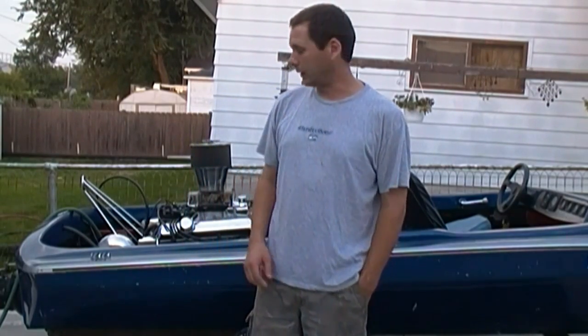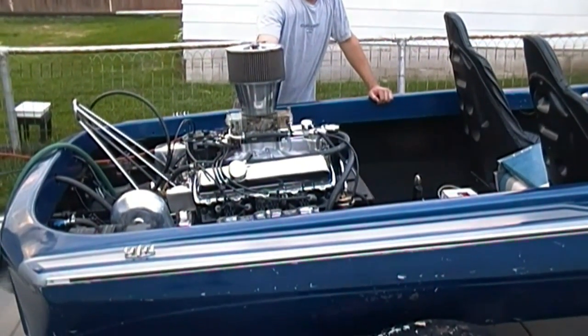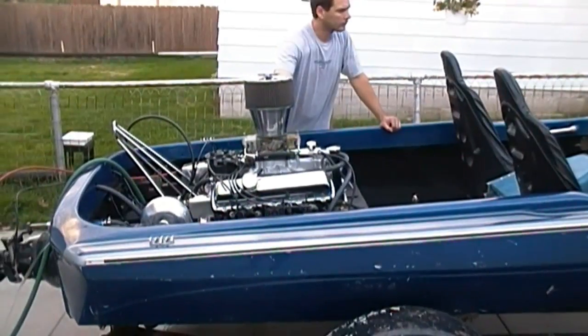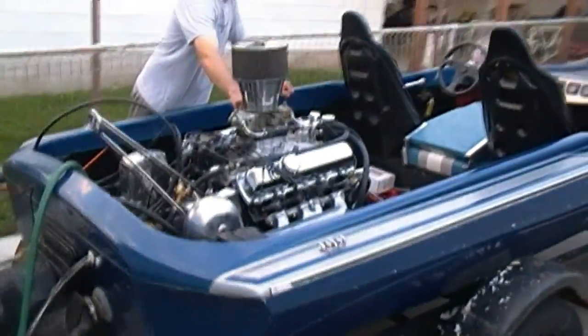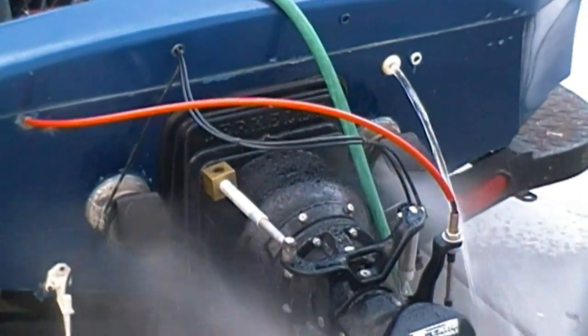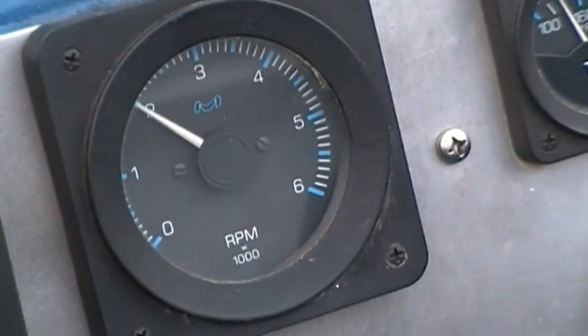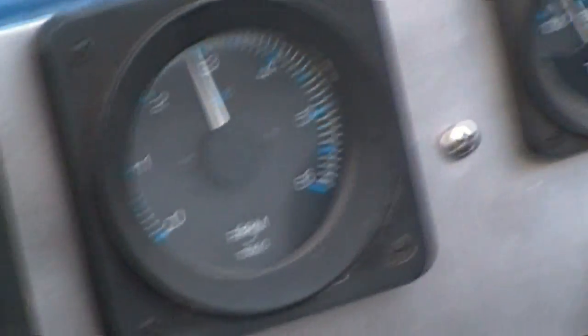Here's take two. I have the soft touch rev control hooked up the hard way now and we're going to go ahead and start it up and try it out and see how it sounds. A little note: you're going to see on the tachometer that it's going to limit a little bit before 3000, so actually my tach is probably a little more accurate than I originally thought. I'm thinking that's maybe to limit the momentum of the engine. While it didn't seem to make a whole lot of difference in my application, maybe it ran a little bit smoother.